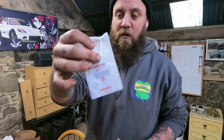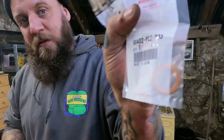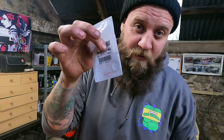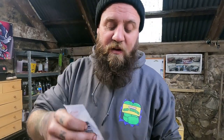The differential has got two different washers — an aluminium one and a copper one. The copper goes on the fill and the aluminium goes on the drain. And how you remember that is: copper top. Copper goes on the fill nut of your diff, ally goes on the drain.